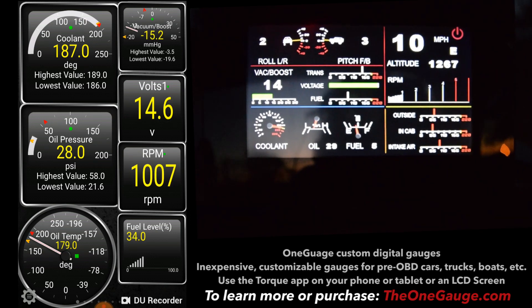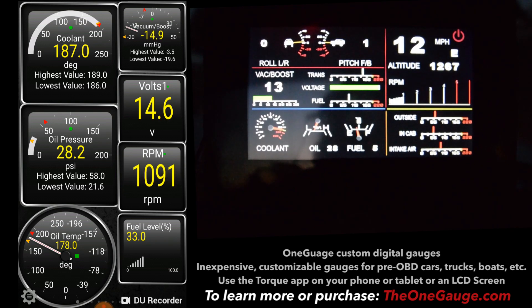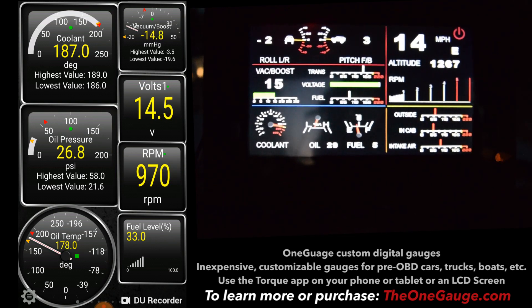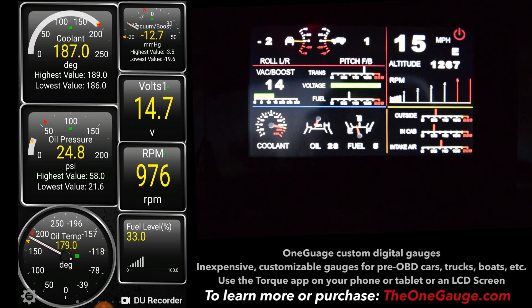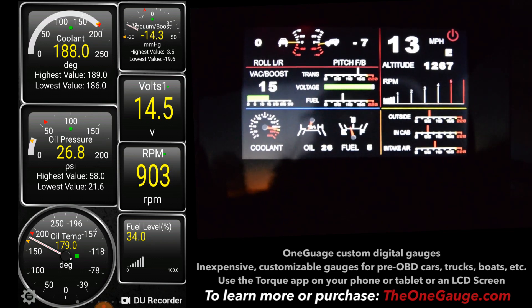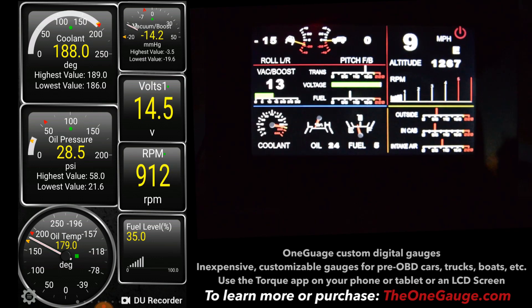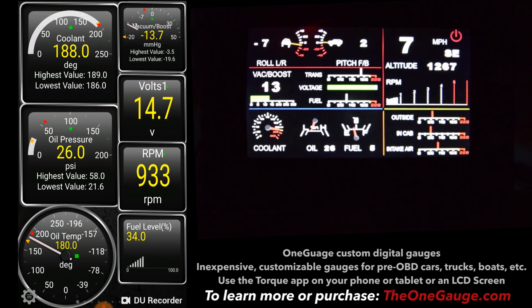You'll notice as well that the tilt gauge is based on an accelerometer, so when you take turns the vehicle may not be tilting all that much, but the accelerometer picks up on the vertical or horizontal acceleration — the g-forces. So an accelerometer is going to be most accurate when you're moving slowly or sitting still; it works best for off-road slow movements.